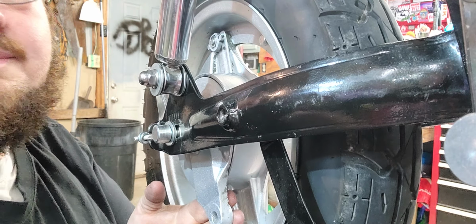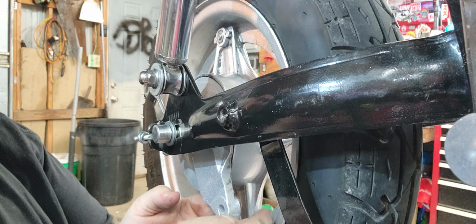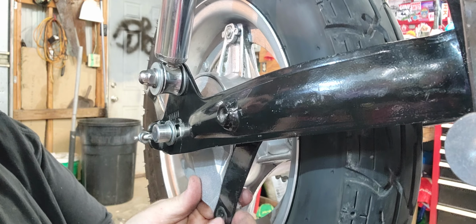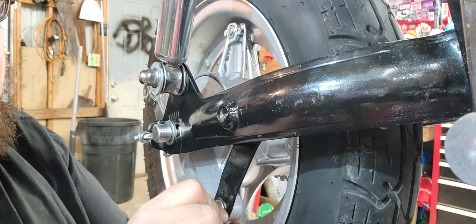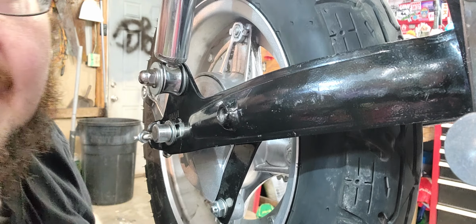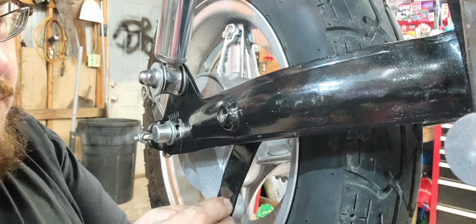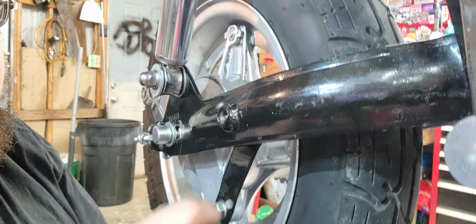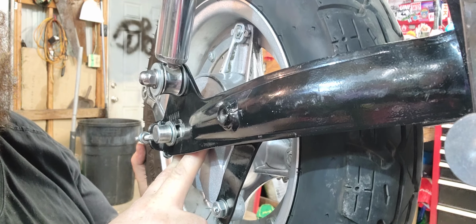We're going to assemble our brake setup. You will have to adjust it. So your bolt with a shoulder goes through the back. And then your washer, yeah, that. Then your washer over top. And your nut. And you don't need to Loctite it. You can if you want, but you don't have to. And then you grab this little baby cotter pin, or a new one, doesn't matter, and just sit it in there. Pry it down a little bit so it's not going to come out. This doesn't need to be ungodly tight, because it all needs to wait and get pushed together whenever you tighten this down.